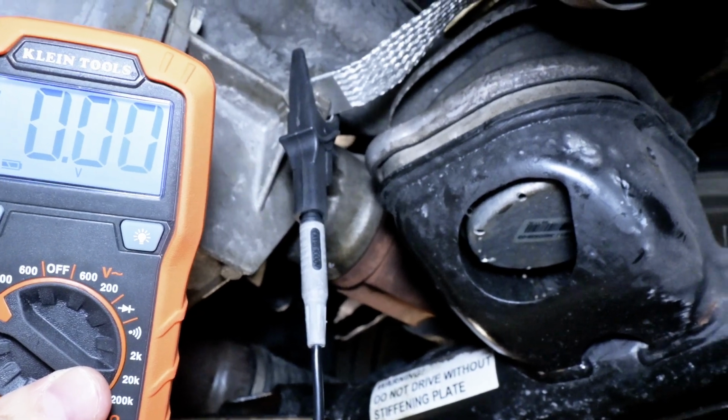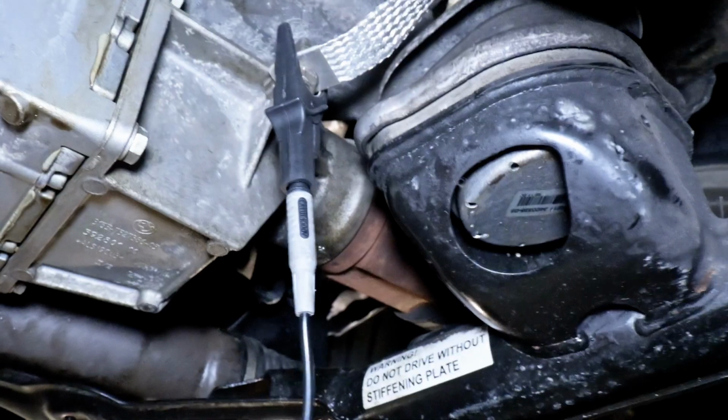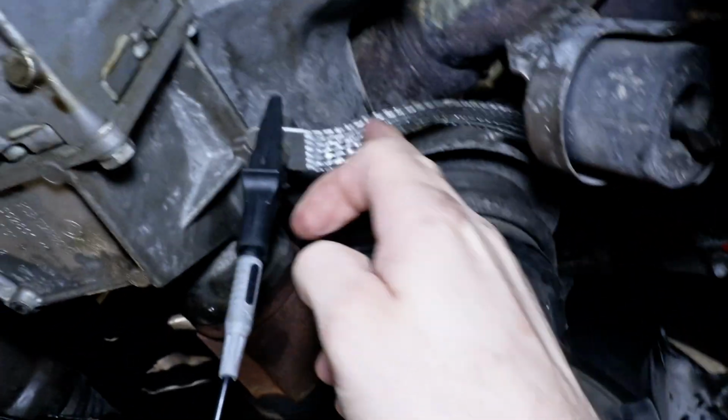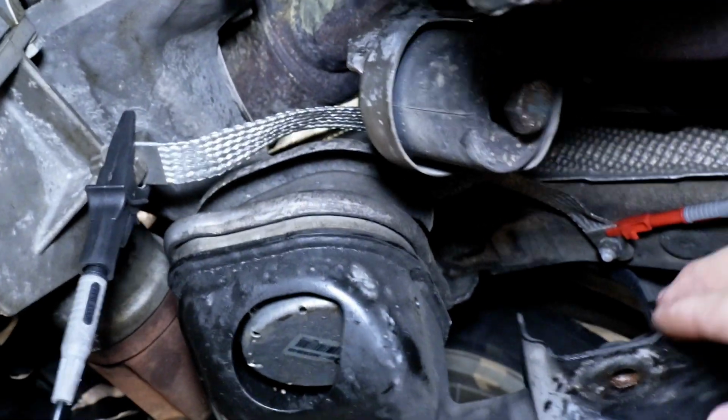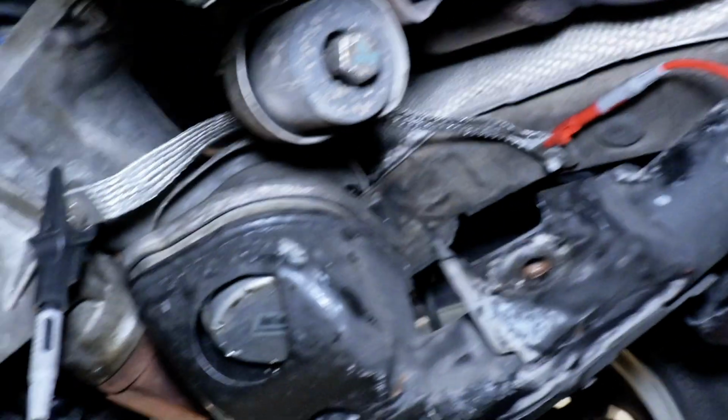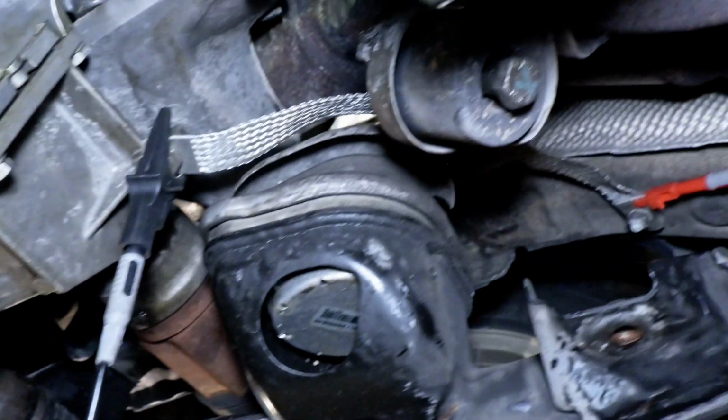Look at that. No voltage drop across the wire, and listen to how much nicer that cranked over. And we even use the proper ground strap. We use these ones because they help reduce electromagnetic interference and radio interference versus just using a regular old cable.